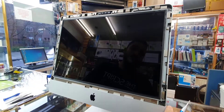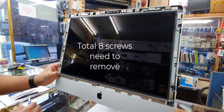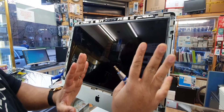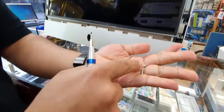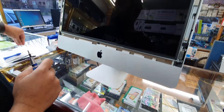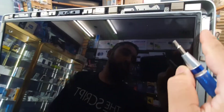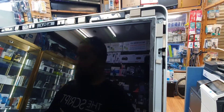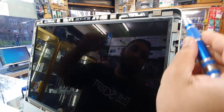With the Torx screwdriver, you need to open up all the screws to disassemble the actual screen. There are eight screws total — one, two, three, four, five, six, seven, eight. I already took out most of them to save time, but I'll show you one. Note that next to each screw there is a high-powered magnet, which makes it a little tricky — Apple designs it this way to discourage independent repair.